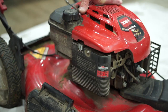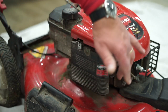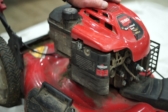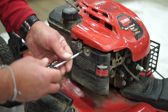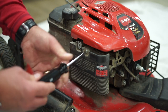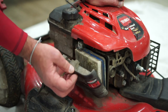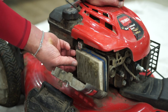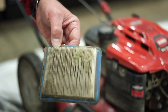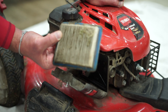Now we're going to go to the air filter. The air filter on this particular lawnmower is on this side of the unit, next to the carburetor. It's typically adjacent to the gas tank on the unit. If you have your owner's manual, it will definitely describe the location. On this particular unit, it's this one screw right here that I'm going to loosen up and remove to expose the air cleaner. A clean air cleaner allows the engine to run more smoothly — it breathes easier, actually helps you get more out of a tank of gas. And as you can see, this filter hasn't been changed in a very long time. When an engine is working with a dirty filter, it can be harder to start, use more fuel, and hinder emissions.